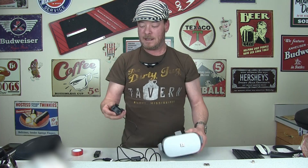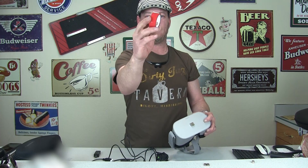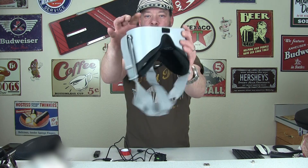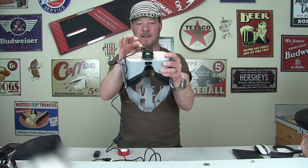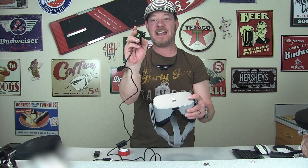The magnets are very low profile, weigh next to nothing, and are very powerful. One reason I inverted the grille on the front was to get it as close as possible. When I used one layer of 3M adhesive tape the magnets were sitting a little too far from the grille — it would hold but was fairly easy to pop off. With two layers of 3M adhesive, it's about the width of a sheet of paper away from the grille and holds really well.